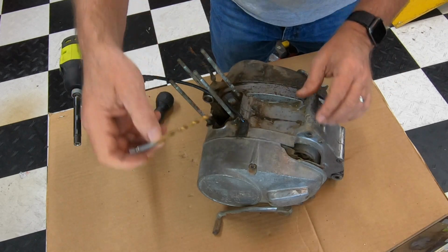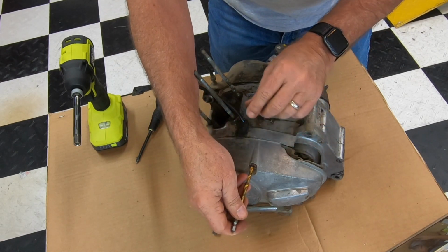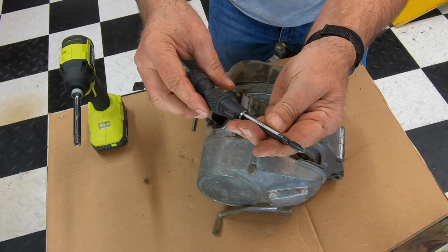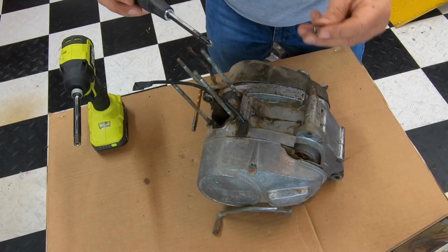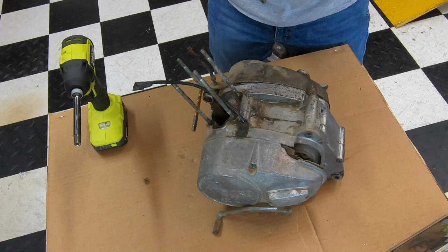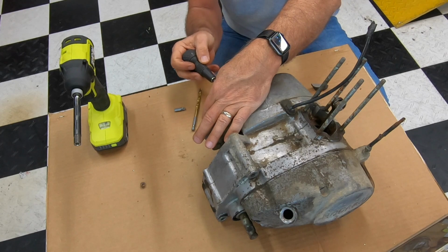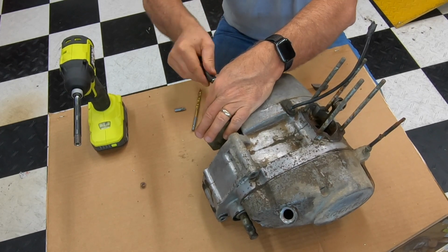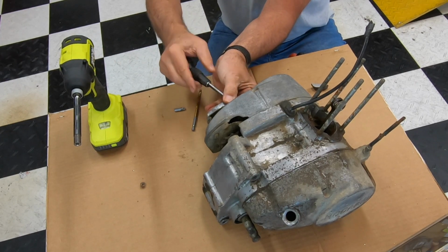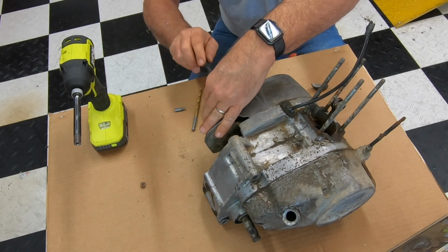Okay, for taking these side covers off, this is the boogered up screw that was right here. I used a 7/32 drill and drilled out the head. So I got that off. And then get yourself a good set of JIS screwdrivers and bits. You'll need a number 2 bit. These are just bits I could put into my impact. Or I got this driver set off Amazon. Every screw on this thing's been boogered up, so it's all part of what you're going to be dealing with probably.